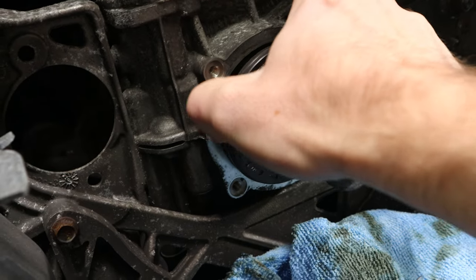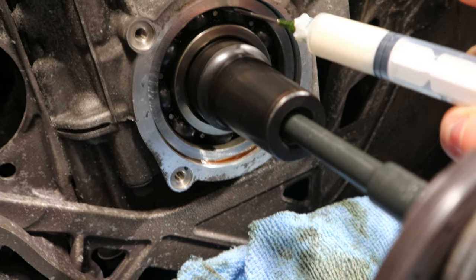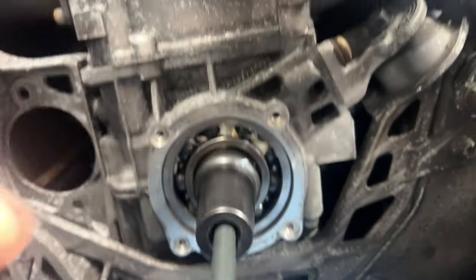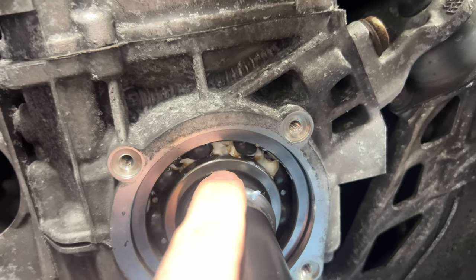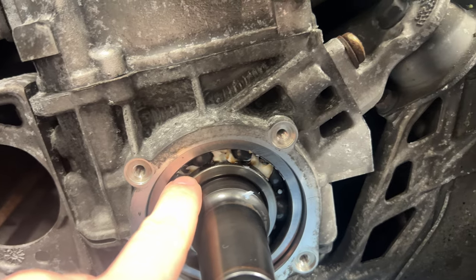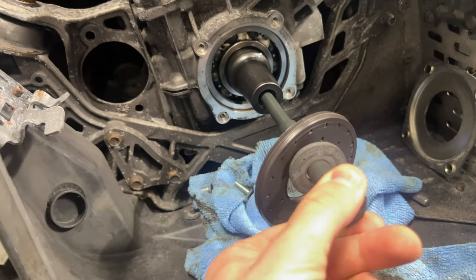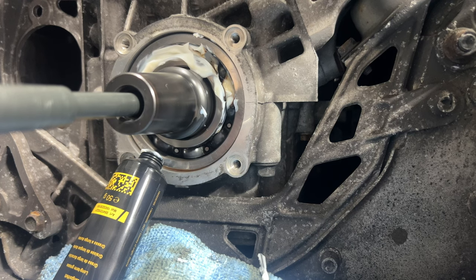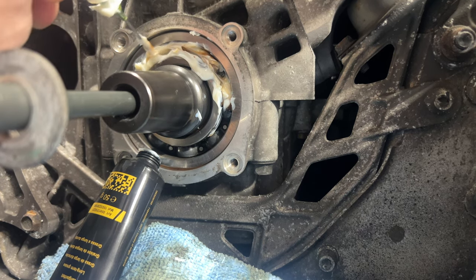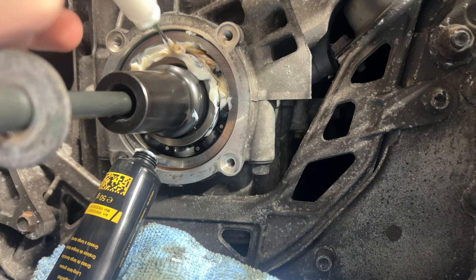Back at the bearing, I'll unscrew the screws — I just put them there so I don't lose them. I'm going to take the syringe and start getting it far back into there. I've been packing it in from the very back, and you can see it's even pushed some of the old grease to the front — you can see that brown coming out. I'm looking all the way past each of the ball bearings. I'll turn the engine over a little bit with the 22 millimeter. In between each ball bearing there's a little hole, and this needle is the perfect size for it — fits perfectly. I'm pushing in between as many of these holes as I can to try to get all the air out so that way it's just grease.